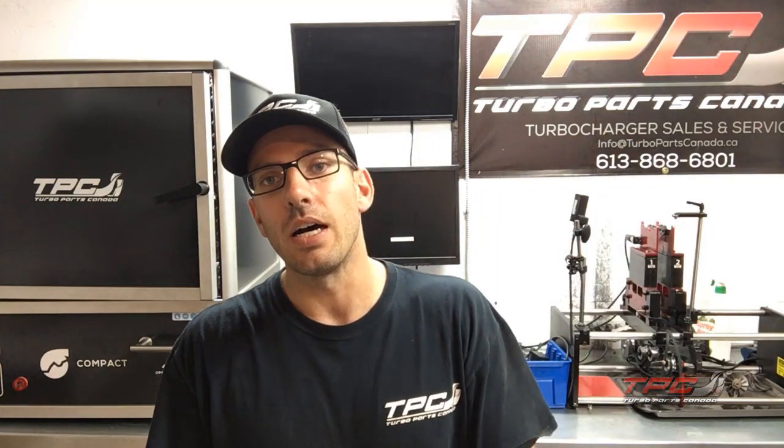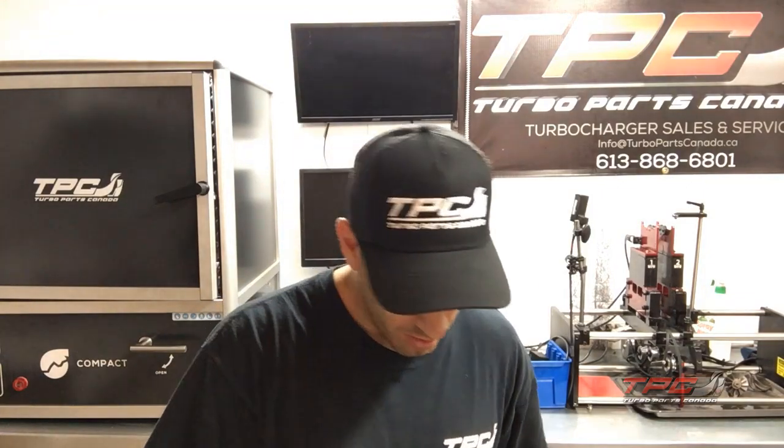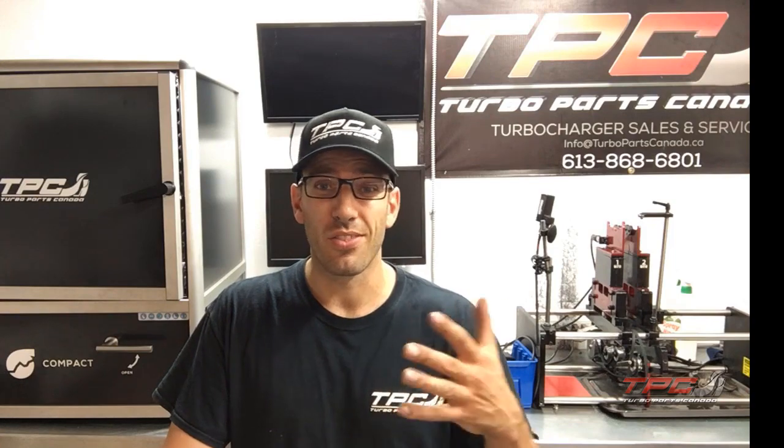We could squeeze a little more — I'll post the dyno graph. It was holding 32 psi, held pretty good till about 7k, then dropped to 30, and by 8k dropped to 27. That was on our 1.2 bar actuator; a 1.5 bar is available separately. This is a full bolt-on turbo — fits the stock intake elbow, stock downpipe, all your lines. It spools around 4200-4300 RPM and you'll hit 30 psi — so that's 30 psi by 4300 RPM, close to 600 hp on E85.